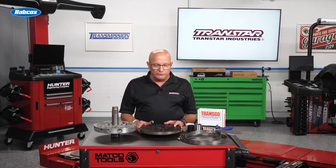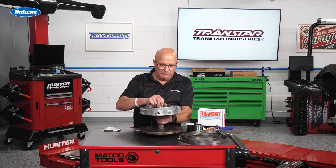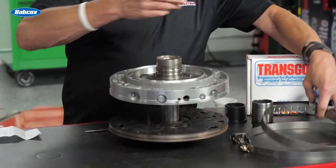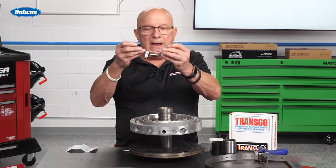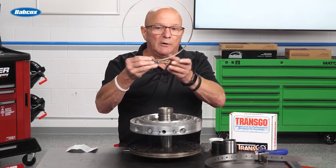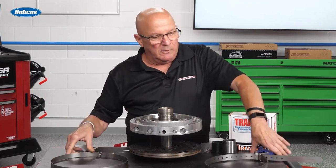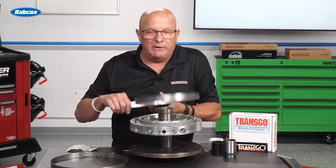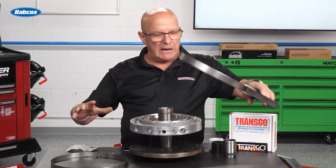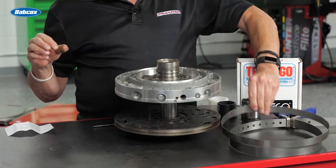The last issue I want to talk about is pump alignment. Since the old days, there have been ways to align pumps. You put the pumps together, pull them together, put the bolts in, and take one of these nice round bands and put it on. They used to have four or five sizes for different pumps — little Chrysler, GM style, the bigger one for Ford. Then they came out with this easily adjustable one for any size. Nice tools to have — do not get rid of them, they're still used on plenty of units. But on a 5R110 it's a bit different.